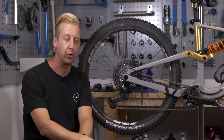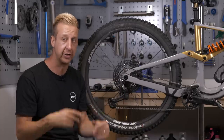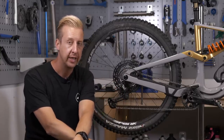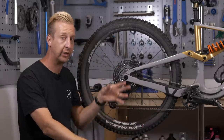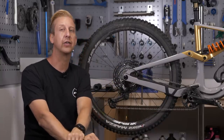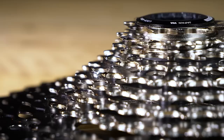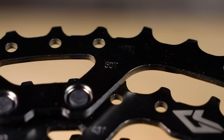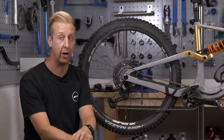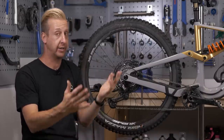You can monitor transmission wear every time you wash your bike. Now, if you're a rider that's going through chains and cassettes constantly and just spending money, you might want to consider a slightly different approach. You could go for a deal to save yourself some cash, but the alternative is to consider something like Shimano's Linkglide. This is an 11-speed only system — it's not currently in 12-speed. However, despite it being much heavier, it lasts on average three times longer. If that sounds like something you're going to make the most of, then it's a dead cert.